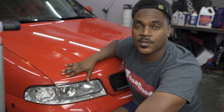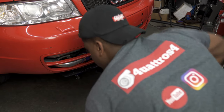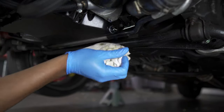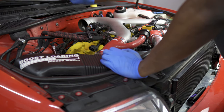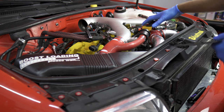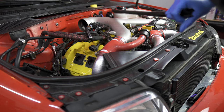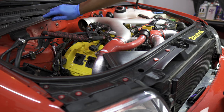There are a bunch of different places we can start, but the first thing we're going to do is jack up the car and drain our oil. After we have our oil drained, the next step is to disconnect our battery—mine is in the back so I went ahead and disconnected that already. Since that's disconnected, we'll start removing all the engine plastic. Go ahead and remove your three engine covers if you have them. The air box is next—pull off the snorkel, then pull off the weather stripping that goes over the battery tray, and then remove the rain tray.